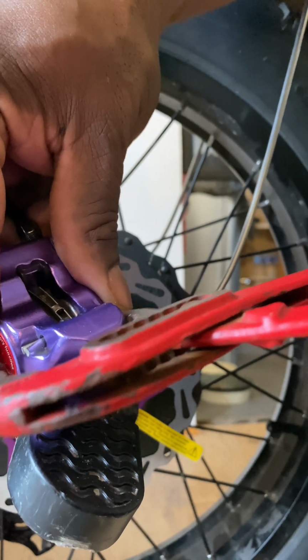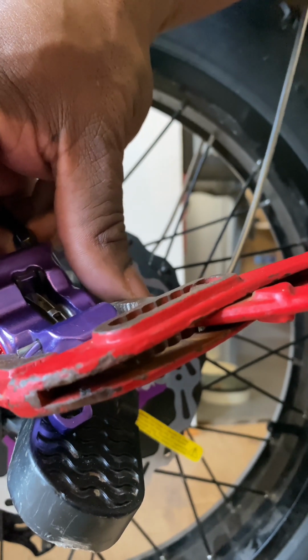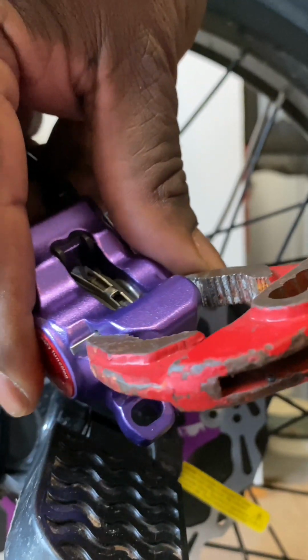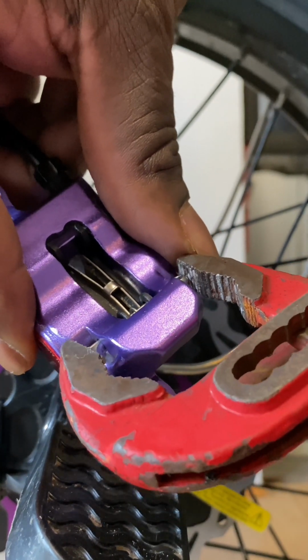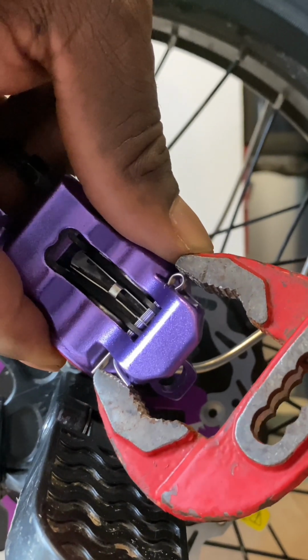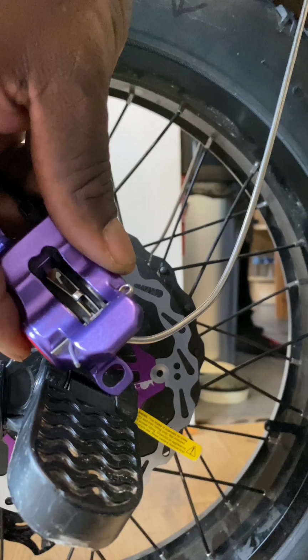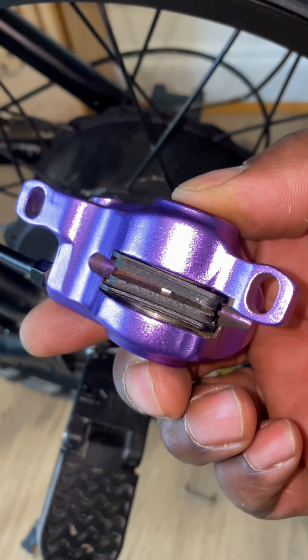Just going to open the split pin so it stays in position with these wide nose pliers. You see there, just securing that there. Best view I can give you, and that's in. So that's the brake pads fitted, and there's a gap in between them. Just highlight that for you. That's where the brake disc goes.